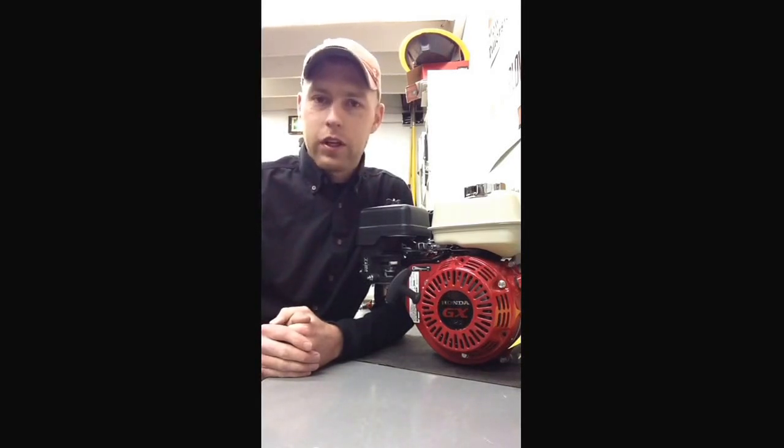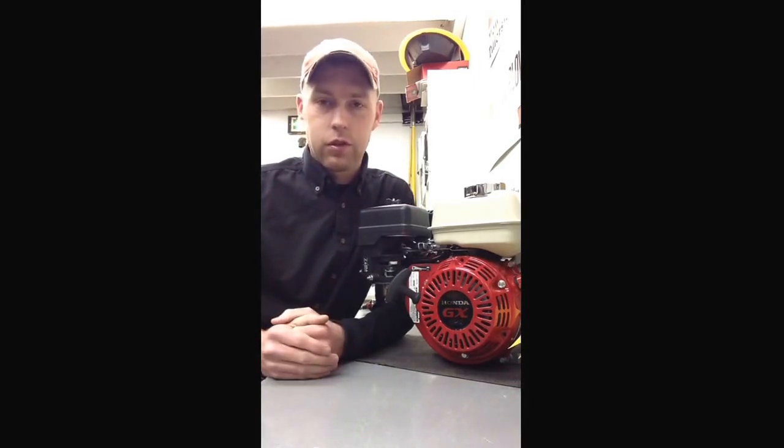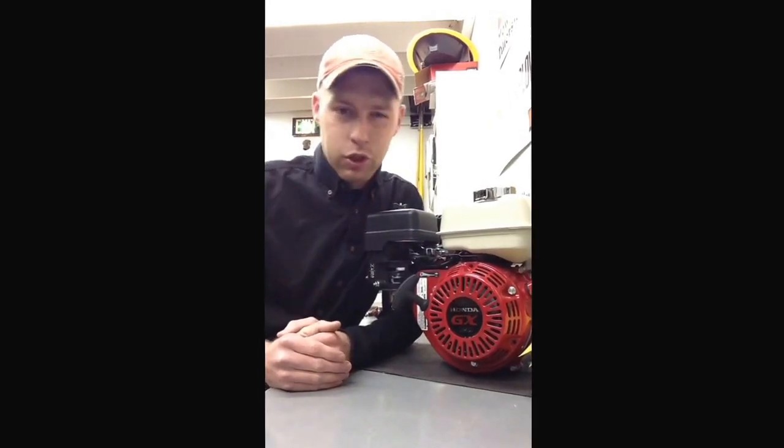The only time you ever have to do that really is if you were to purchase a replacement engine through the mail or through your local dealer and they say you need to rotate the gearbox before you install it on the machine. Some dealers are courteous enough to do that in the store for you — you just simply have to ask them. Otherwise, if you get it in the mail straight out of the box, Honda lots of times will package them in a more convenient way and they're designed for other applications. So in our industry where we're using them for aerators, we have to typically rotate the gearbox before it can be used or installed on the machine. Let me show you what I'm talking about here.